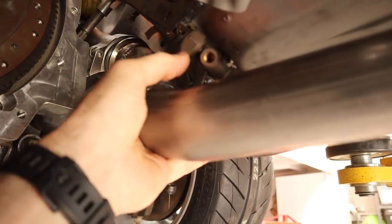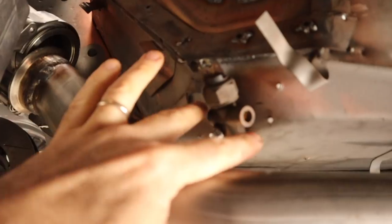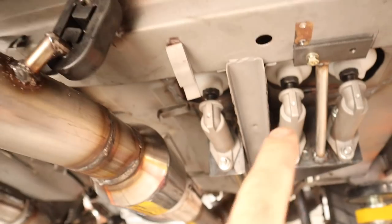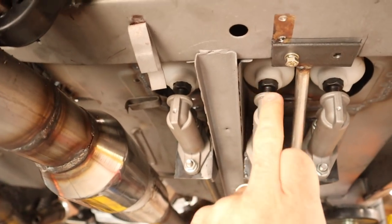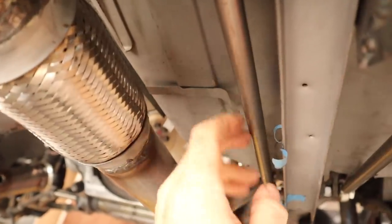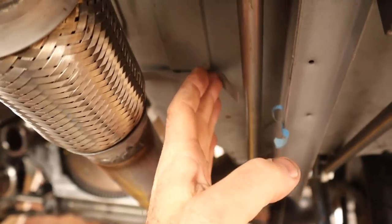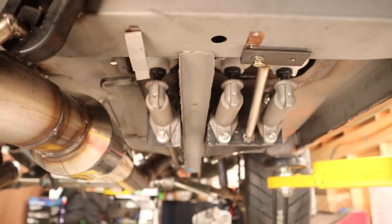You can see where my brake switch and t-piece is. I have the two sides here that will go from it to either side of the front brakes. I need to now make my front brake line going from probably this master cylinder, coming around and going along the front, tucking up - I've got the exhaust back in just so I know exactly where I've got room. I'll run it down here and connect it up. So first brake line - let's start making it.